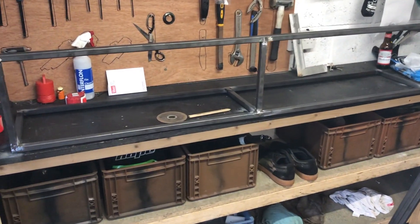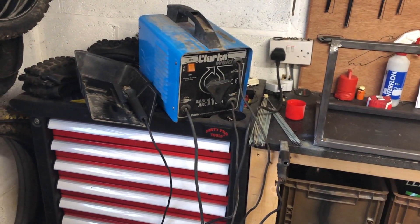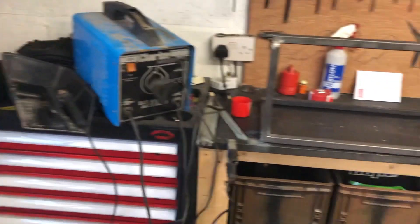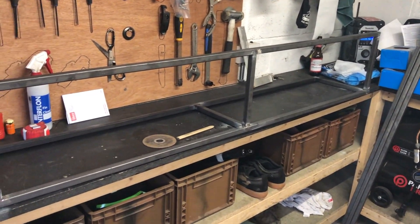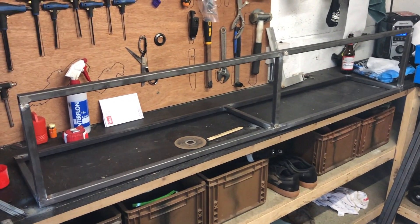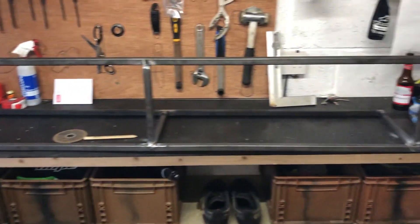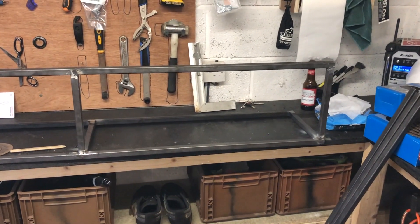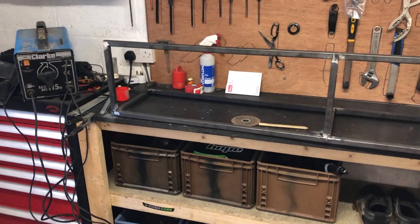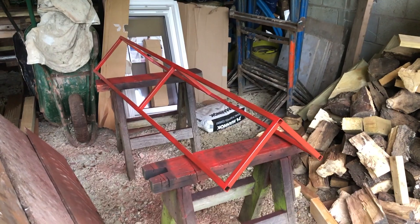The weld has come out — I have only got a cheap welder, a cheap £100 thing from Machine Mart. I've welded that frame together, now give it a bit of a clean up. It'll get a lick of spray paint obviously before I fix it. Then that'll be basically lined across the front to the sides with a border in the back, then fitted to the roof of the van. It's all made, give it a coat of red oxide primer with all the red stuff we're putting in there.